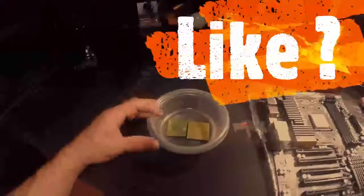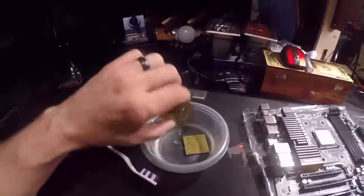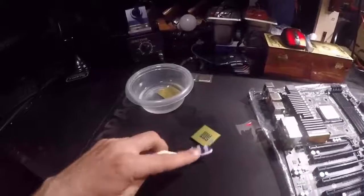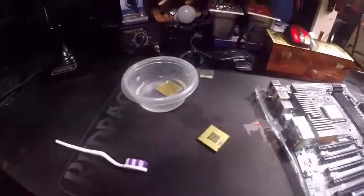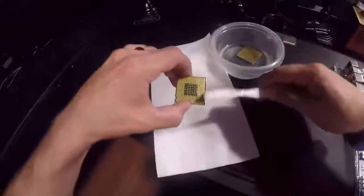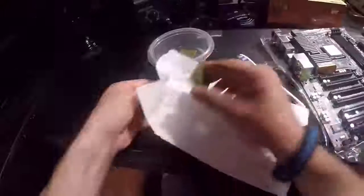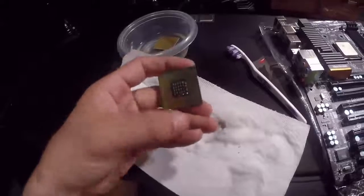Okay, so it's been about two days, maybe a day and a half. I'm going to go ahead and take this out. A paper towel is a good idea too, because once the thermal paste transfers to the toothbrush you'll need to wipe the brush clean on something. Let's put a little more alcohol on the brush and scrub it softly until we get all that thermal paste out.